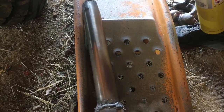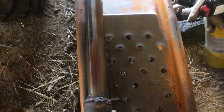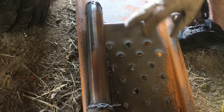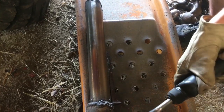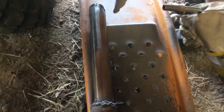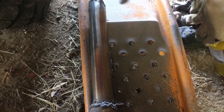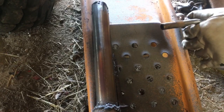Okay, so I obviously know it's not completely blue, but I don't know if you guys see that or not. But you want it brown because I still have another half of this pipe to do, and heat obviously transfers because it's metal. So while you're heating up one side, don't do it completely yet, because the heat is still going around and down on it. When you're doing one half, you're actually doing a little bit more on a pipe like this. So you want it to cool down a little bit when you're doing one side, because this way I did long ways and I did it up and down, gives it a more even color. So I'm gonna let this cool down and then we're gonna go back at it in a minute.